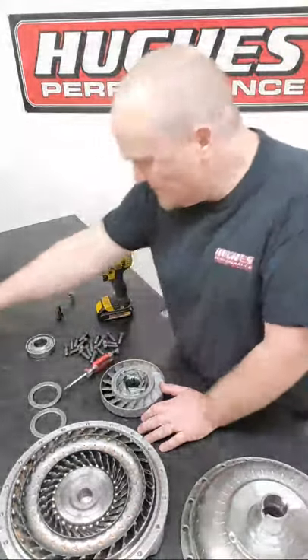I don't recommend just hammering on them with an impact because you don't know the amount of torque generated, and with power tools it's easy to generate too much torque. In a soft aluminum cover it's easy to damage or pull threads. Do yourself a favor - take the extra five minutes to use a torque wrench. Again the specs: dry threads 51 foot-pounds, lubricated threads 38 foot-pounds - definitely recommend thread lubricant. I wouldn't use Loctite because you don't want to damage those aluminum threads. If you insist on Loctite, use blue - don't use red or green.